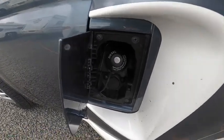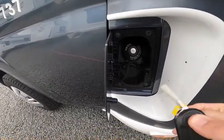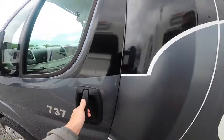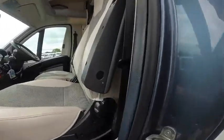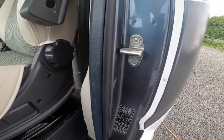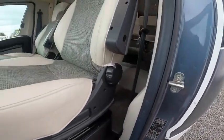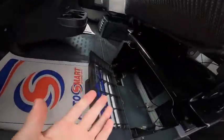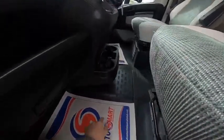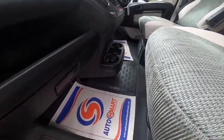You've got your diesel filler at the passenger door, which opens with the main flip key for the van - you can open your diesel filler and fill with diesel fuel. Tyre pressures are 5 bar on the front which is 72.3 psi, and 5.5 bar on the back which is 79.5 psi. Your leisure battery lives underneath your cab seat on the passenger side. The panel in the floor is where your engine battery lives, so you've got to take that off to get access to it. Your bonnet release is on the side of the dashboard.